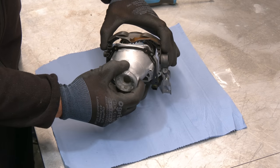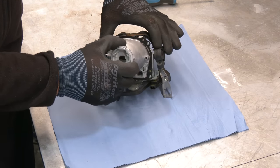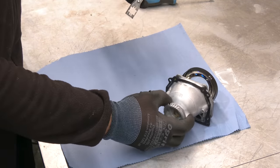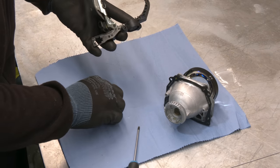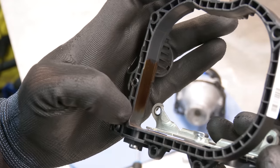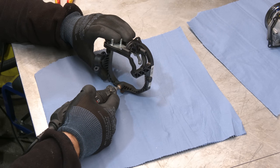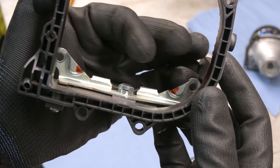This is what happens when you try to fit the projector. It's sitting here on the top, on the sides as well. So all of that we need to grind down with a Dremel or something, and then it'll fit and this will be able to move freely inside. So first we're gonna remove this bracket here. I marked with the marker all of the places where we need to thin out the bracket, here, here as well, all of this, and then on the top, these fins here. We also need to grind out the corners of the bracket here.